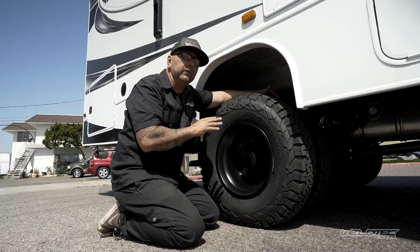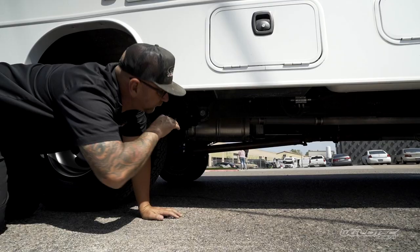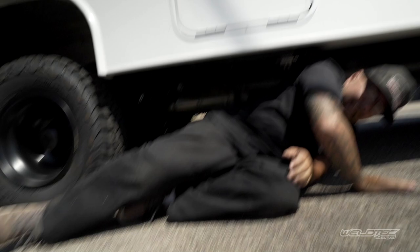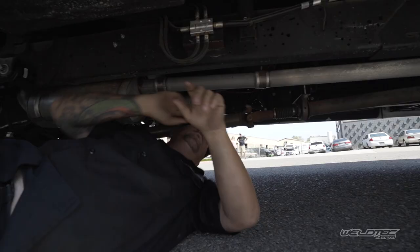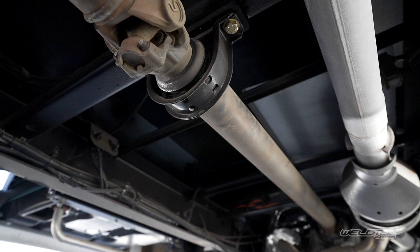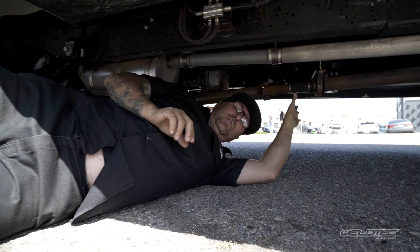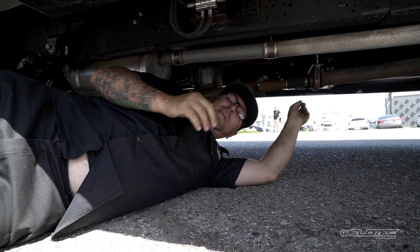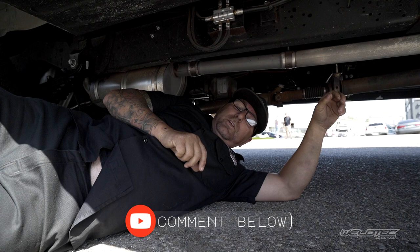If you're going to do this kit at home, you will need to add some spacers on your drive shaft. I'm going to crawl under there and show you guys this. You can see right in here, we had to add this spacer to bring the drive shaft down. What we want is a straight line going all the way back to the rear. We've also added some quarter-inch shims on that first drive shaft. Depending on your RV, how long it is, and how many carrier bearings you have, you may need to shim the carrier bearings down to reduce vibration when putting a lift kit like this on your vehicle. It's not a problem — just want to show it to you. If you have more questions about aligning your drive shaft, comment below and I'll make a whole video on it.